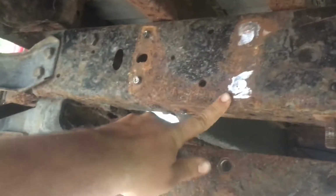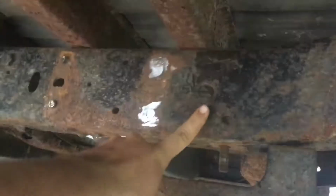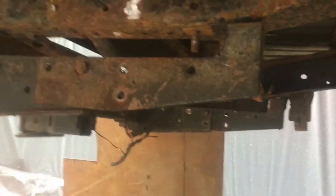There's the springs. I actually thought these were 56s. That's what my friend said they were. Turns out they're not. They're 52s. And this truck had 56s, but it kind of works out because I don't know if all 3/4 tons are like this, but his is. These are the original shackle mounts, but he also has the holes for the 52-inch springs. So I'm going to drill these out and put a shackle flip in there.